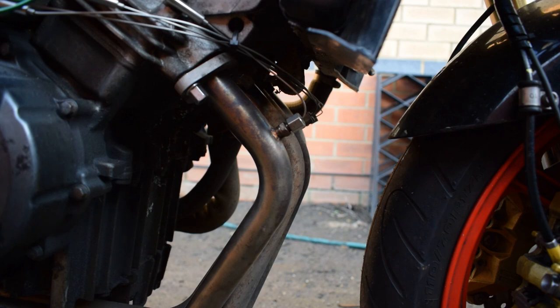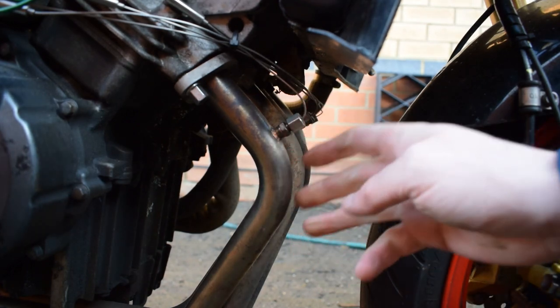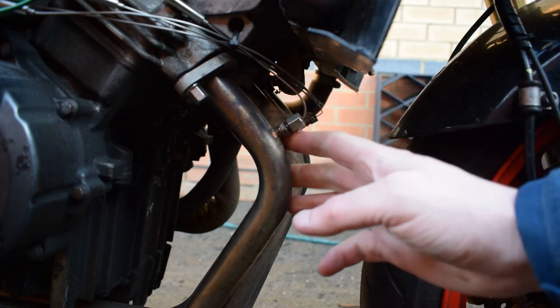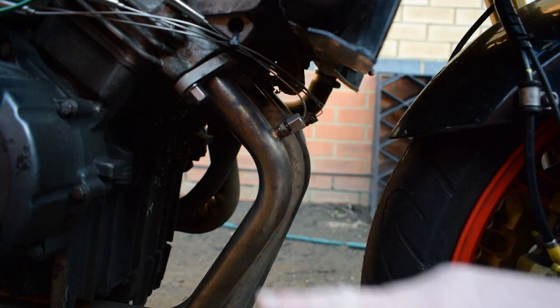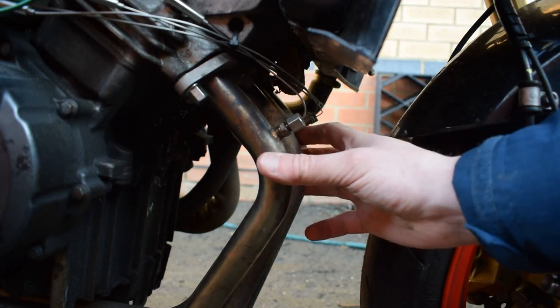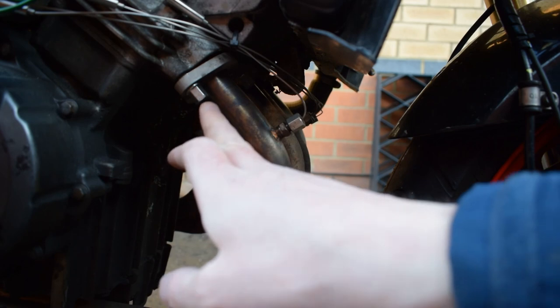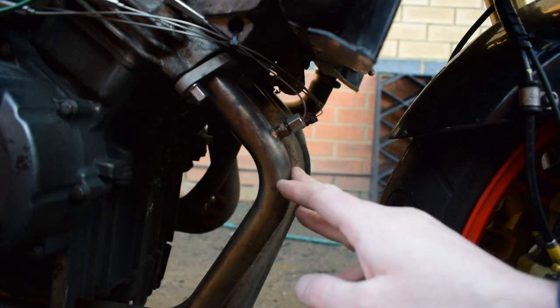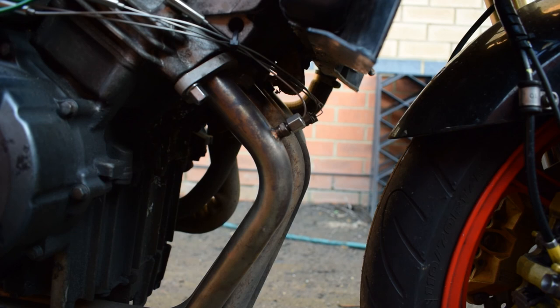So the last thing really to show here is the exhaust system. Here you can see the K-types that I've installed. They're 1.5 mil K-types, and just welded in compression fittings into each header, so I can get the individual gas temp of each cylinder. Now, the distance from the header here was just arbitrarily chosen to allow the flanges to be removed and all, but they're all the same distance from the cylinder head port.